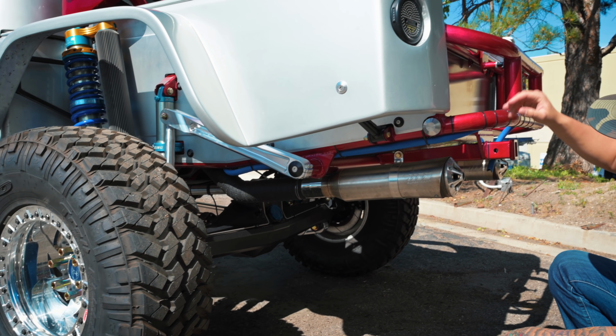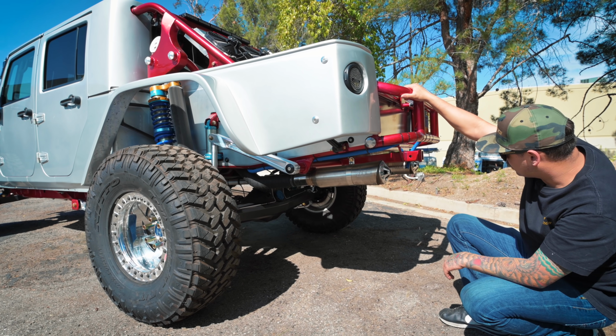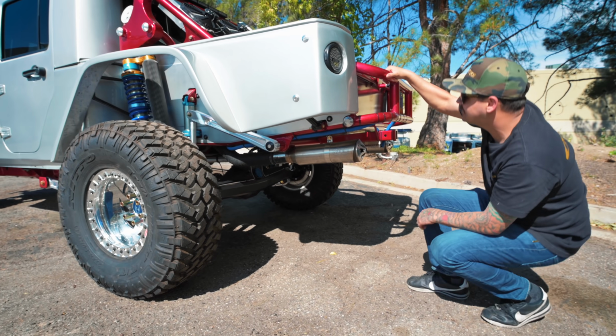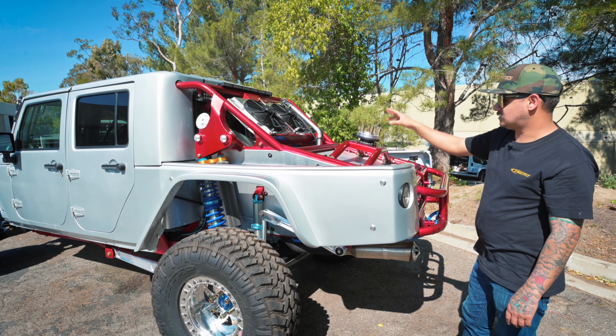This right here is a fuel vent. We added that. It just had a filter on top of the discriminator valve and that wasn't working. So when I drove it, it just kind of dumped fuel all over the fuel cell and the exhaust. So that's no good, so we changed that. Radiator in the back. It had the two oil coolers there.